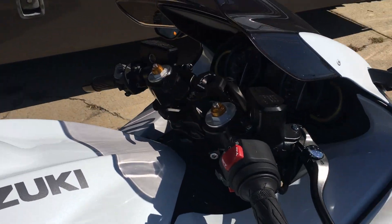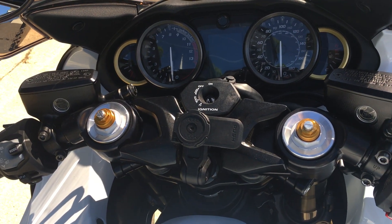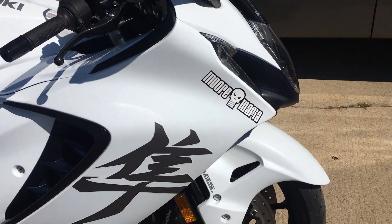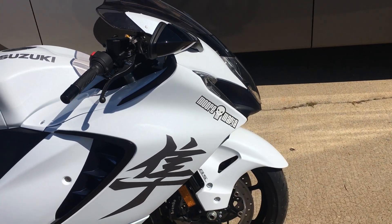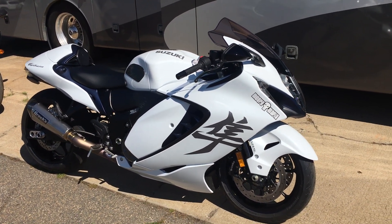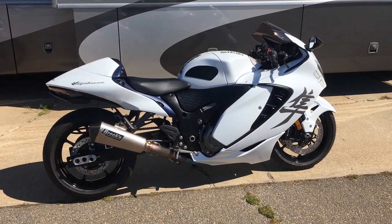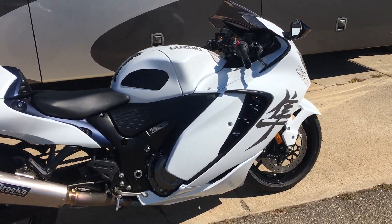We lowered the front end by putting these HTP handlebars set up on it, which gives you the opportunity to slide the fork legs up through the triple trees, which lowers the front end essentially — which works out really really nice. He is a big fan of the YouTube More Mafia channel and that's how he got connected with us. He also has his own YouTube channel, so please check out Choker TV Modified. This gentleman is a retired police officer out of the Chicago area, so we certainly do appreciate his service over the last 30 plus years. Now that he's enjoying retirement, he always wanted a Busa and he got one.